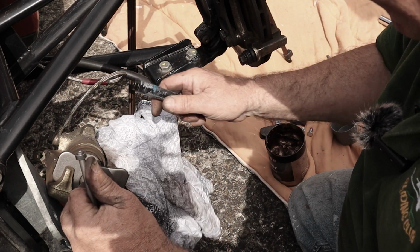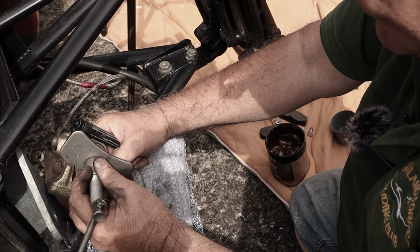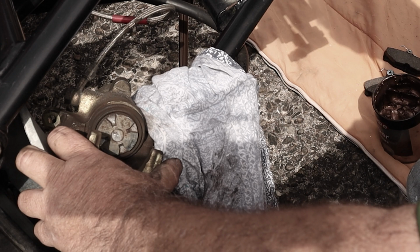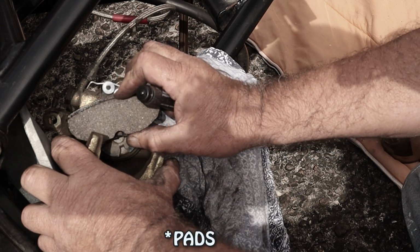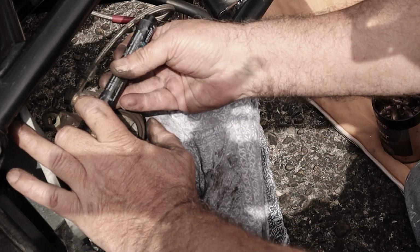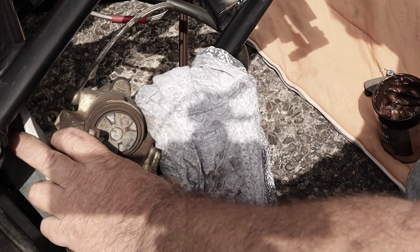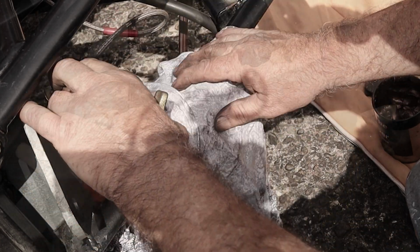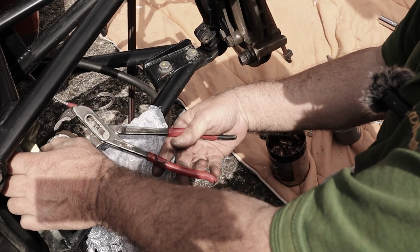Now I forgot to actually do it then, but what I should have done is, now that's out, wind that back out, and that's now pushed your piston in. But these gaps line up with these little nipples there on the shoes, so you're best putting a line here right in the centre, or where one of the gaps were, and make sure that is right round at that line, otherwise the little lugs don't line up with the pads.